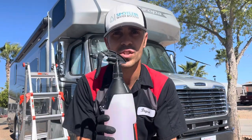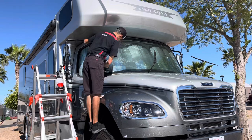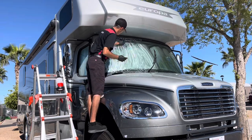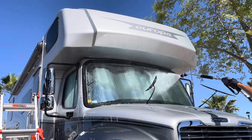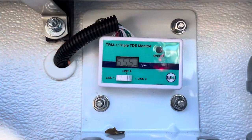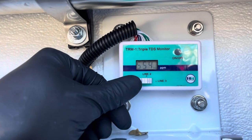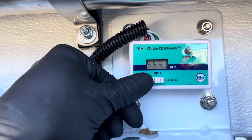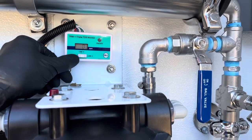We're going to follow the same process with Extra Tough on the windshield. I want to show you guys why it is absolutely mission critical to never wash an RV with tap water. Look at how hard the water is here at this RV resort — 555 parts per million. As it leaves my RO system, I'm able to strip it down from 555 all the way to zero parts per million, and that's the water going into my tank, making my life a whole lot easier.